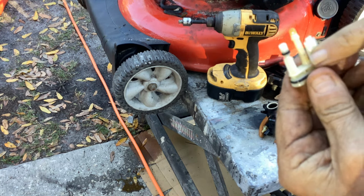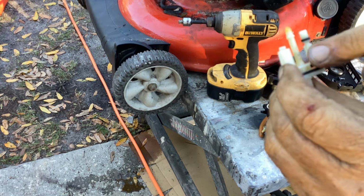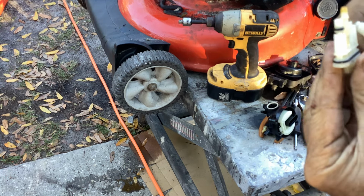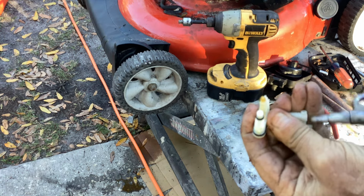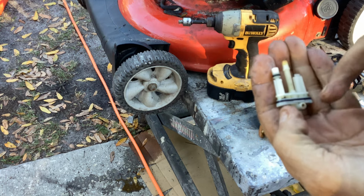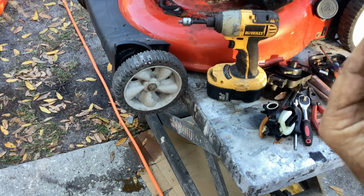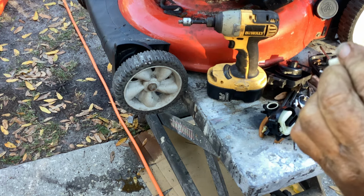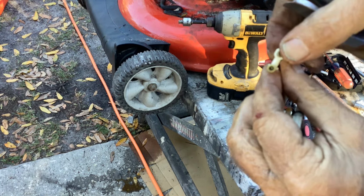One hole blocked there, we'll blast that out. It's got some snot all the way through the back of the hole. So let's blast that off right now. I won't make the mistake of not cleaning the tube here like I did on the Bolins, that still had a blockage. I ended up having to do the job twice. Okay, that's clean on that one.